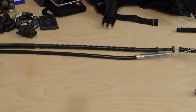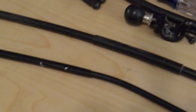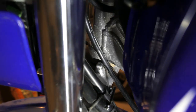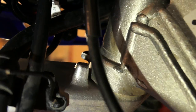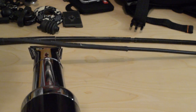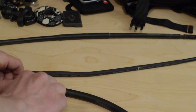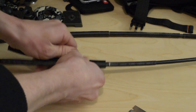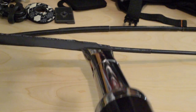Comparing the two cables they are very similar except the stock one has a heat shield, thicker protection in the middle, and the new one is missing the little bushing around the cable end. I'm going to test fit it on the bike. So it looks like it's getting pinched right here in between the steering head and the end stop lug — you can tell the stock one has been rubbing up against the same area, which is why it has really thick protection in this spot. I'll mark where there needs to be extra thickness, add some shrink tubing to repair that pinched part, then take an old vacuum hose, cut it to match the marks, split it down the center with a razor blade, place it around the cable, add some electrical tape, and finish it off with a bigger piece of shrink wrap.